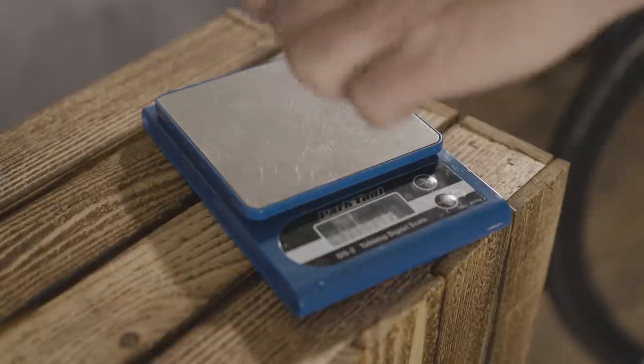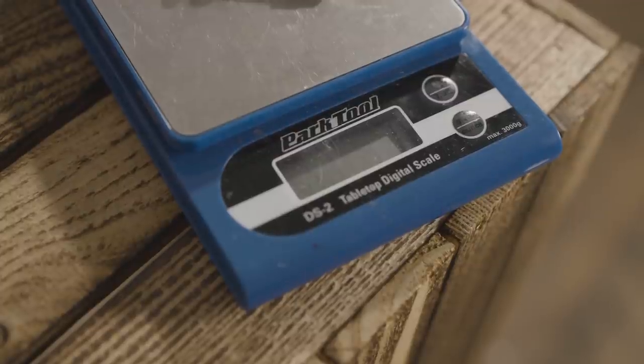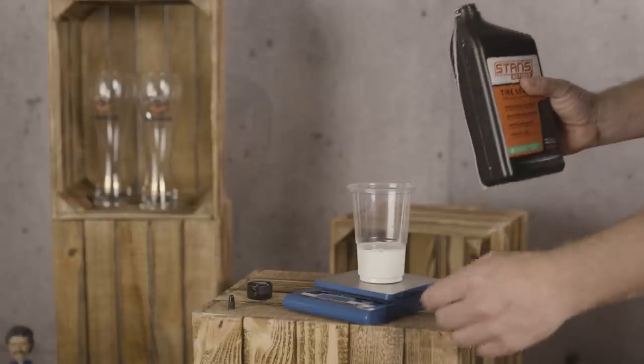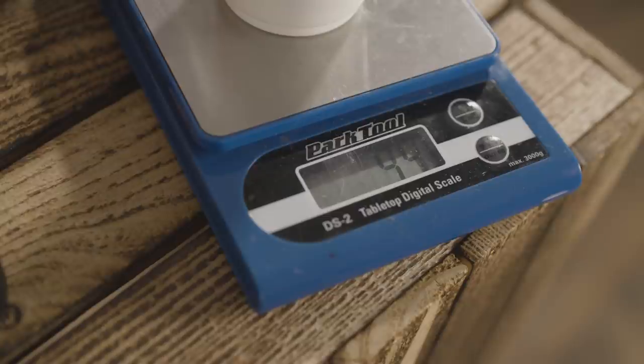The extra material needed to make a tubeless tyre, and in some cases the rim as well with additional rim strips, plus the tubeless valves and necessary sealant, means that even though you're ditching the inner tube, a tubeless setup can be heavier. The tyres are generally heavier too — a Continental GP5000 TL 28mm tyre weighs 340g versus 250g for the regular version. Removing the inner tube saves you in the region of 100g, but you're adding back 50–60g of sealant, which negates some of the weight saved, and those tubeless valves are probably a little heavier too. So don't go expecting tubeless to shed loads of weight from your bike, but in some cases it can save a small amount.